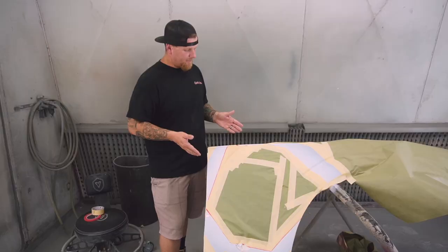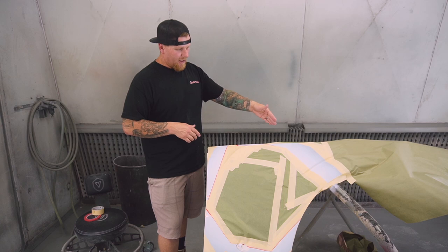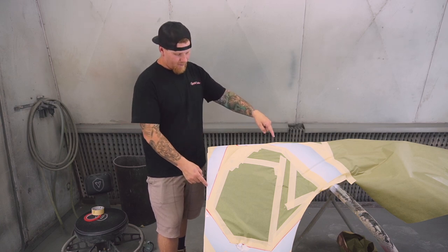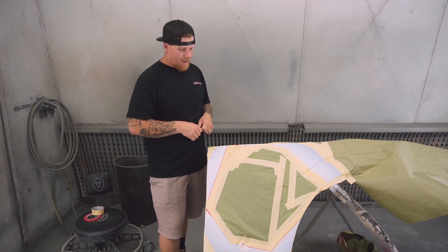We made sure we had about a third of a surface area for the bus bar. And we're just going to come through. We're going to make sure that from here to here, once we get it sprayed, we have under 10 ohms, and then we're going to continue.